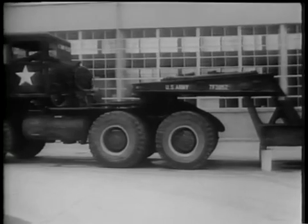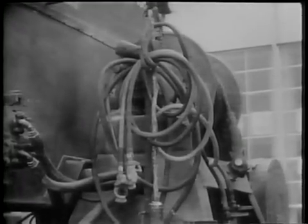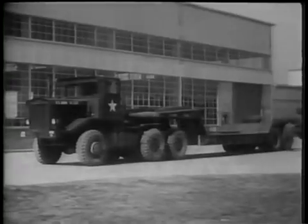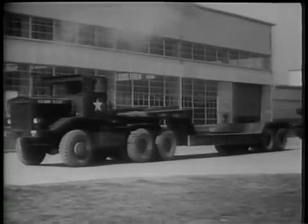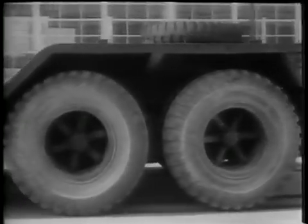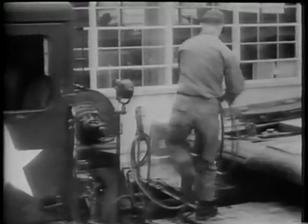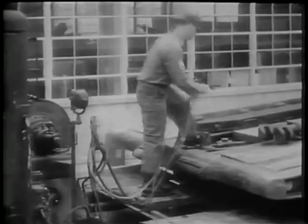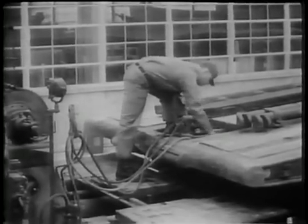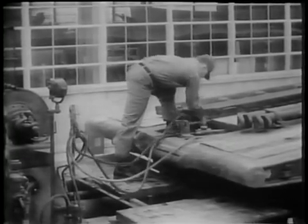When the trailer is separated from its tractor, or when the units are coupled and the air supply disconnected, safety brakes are automatically applied to the trailer wheels. As long as there is air pressure in the trailer reservoir, this safety feature prevents the trailer wheels from rolling. When the tractor air supply is again connected to the trailer, its pressure is applied to the emergency relay valve on the trailer. This valve releases the safety brake and permits the trailer wheels to roll.